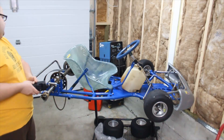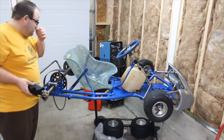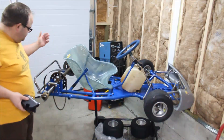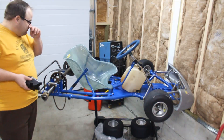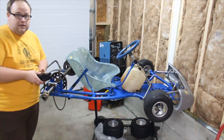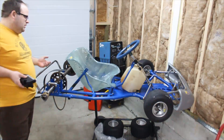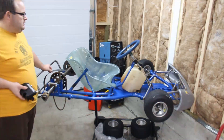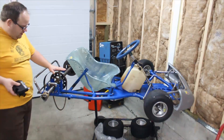I was working out the brake caliper — unfortunately I need some longer bolts. I'm doing everything in metric to keep with the fact that this is an Italian frame. Home Depot and local retailers are pretty limited on metric bolt selection, so I'm going to find a fastener supply place to work that out. I'm using a standard caliper and standard brake master cylinder, but they didn't line up with the existing bolt holes, so I've had to make some adjustments and drill some holes for mounting.